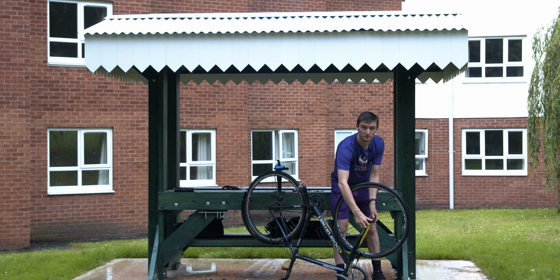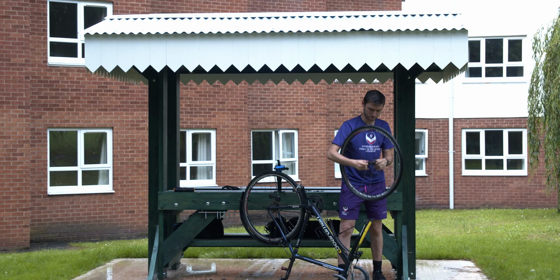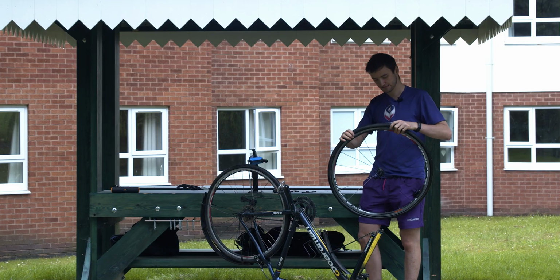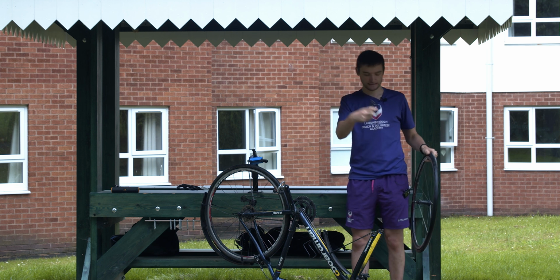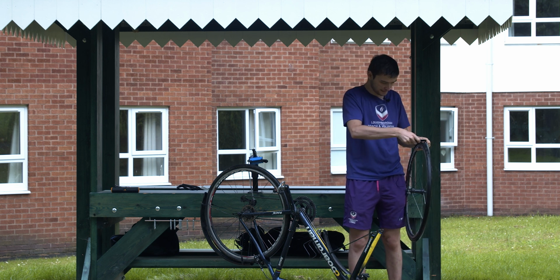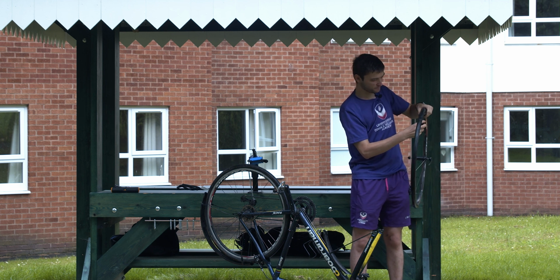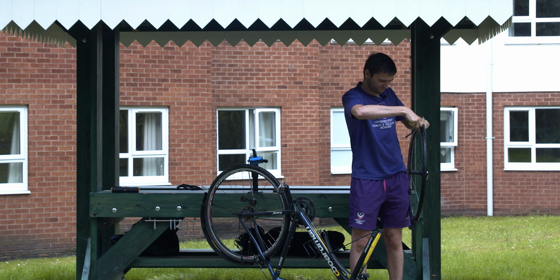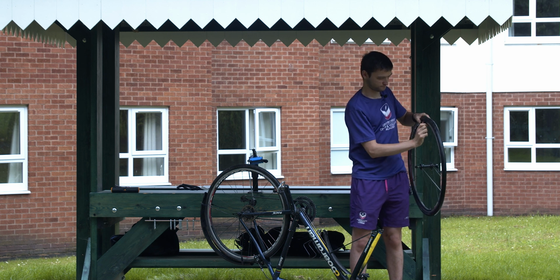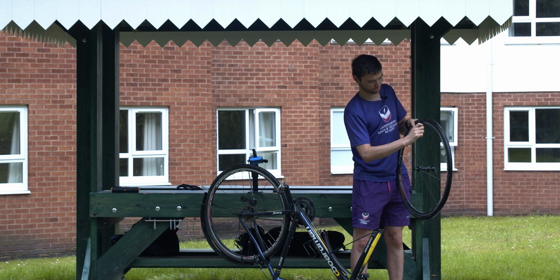We're going to firstly pop that quick release and undo it. And then we should be able to simply pull your wheel out. Okay, next stage is we want to take this tyre off. So we're going to grab 2 tyre levers. We're going to literally clip them under the tyre, 1, and again, number 2. Then we're going to run one of them round the wheel.